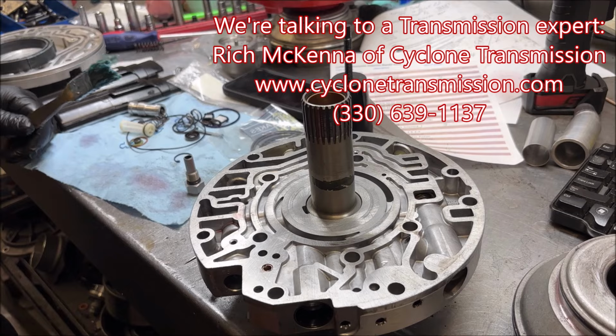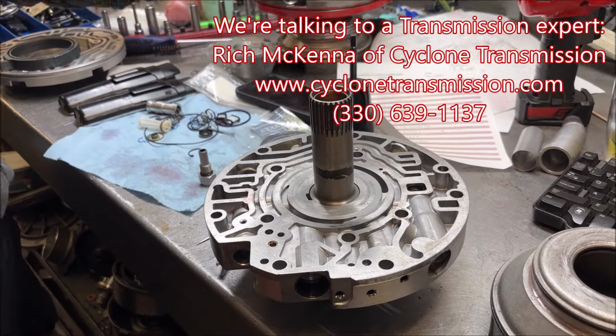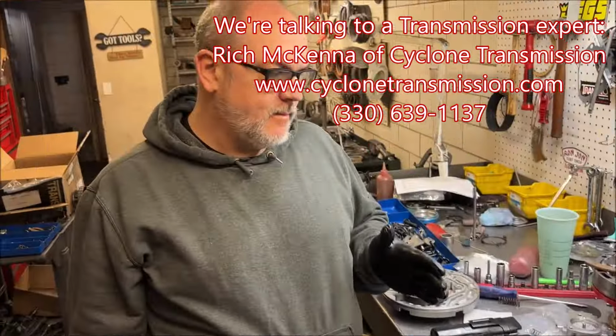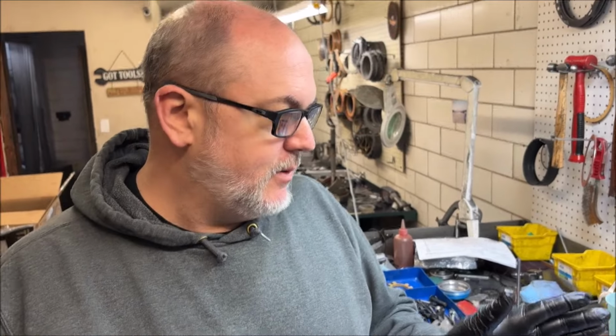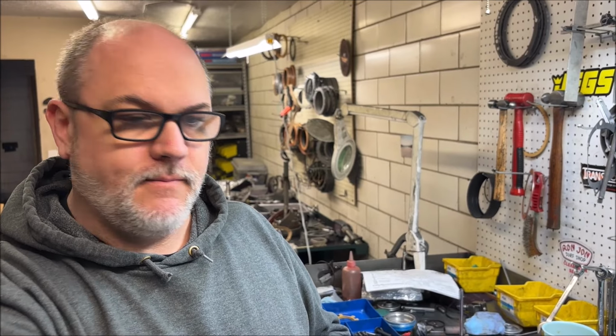Yeah, the most important thing to remember, though, is to take a measurement from the face of the bell housing on the trans. I don't have a bell housing here, but yeah. The face of the bell housing to the mounting pad on the converter should be 1 inch. That's the first thing. The transmission bell housing mounting surface. I'll put in a diagram here. To the mounting face of the 4L80E, converter to flex plate mounting pad should be 1 inch. Yes.